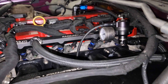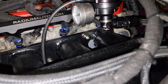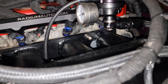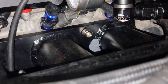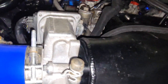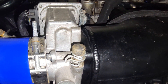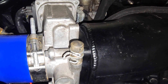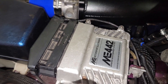The vehicle is now heat soaked and it will not restart. At this point of the tune, it should fire right back up. I did notice there's some kind of JB weld or epoxy on that intake manifold weld, which is not reassuring, but that shouldn't be causing the no-start. I've also noticed that when the key is in the on position with the engine off, the throttle body just freaks out — it's opening and closing super quickly.